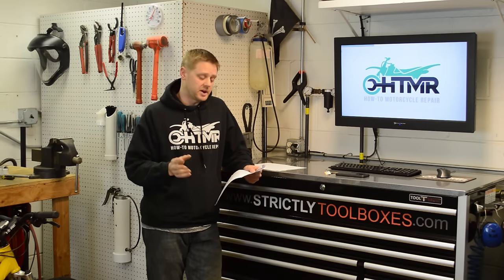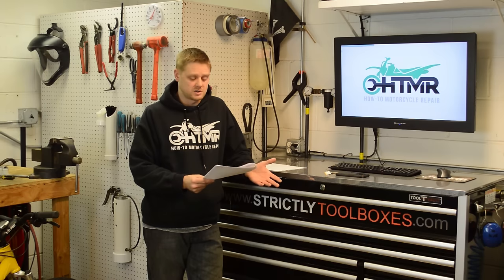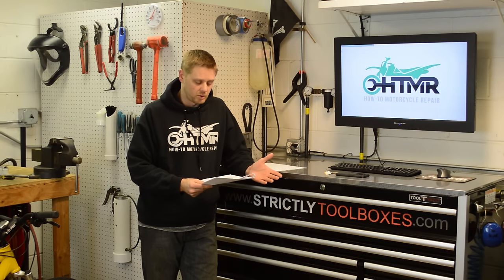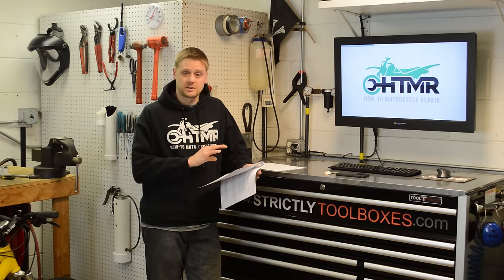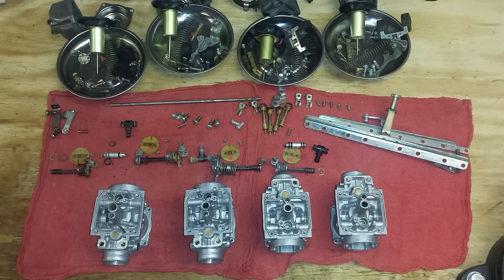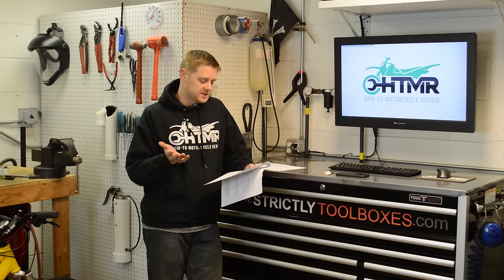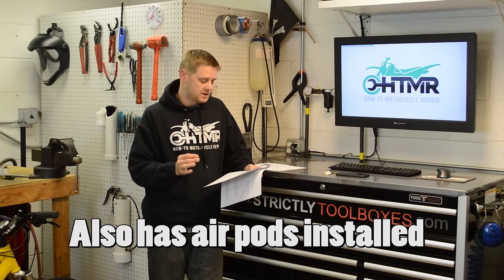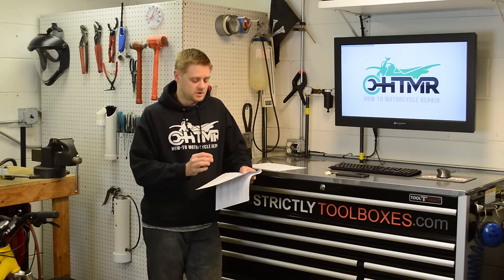Okay, let's talk about the bike in this video. It's a '90 Yamaha Radian with good compression, 150 PSI across the board, no vacuum leaks, and the carbs are clean. I took the carbs completely apart to get rid of the vacuum leaks on the throttle shaft seals. I soda blasted and ultrasonic cleaned the carbs. It has a jet kit in it, and the stock pilots were 30. I went 2 sizes larger to 35, and the fuel screws ended up at 3 1/4 turns out.